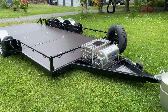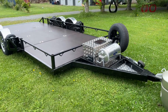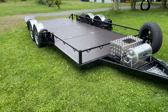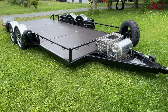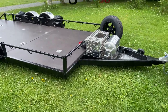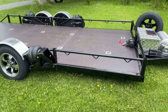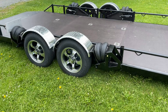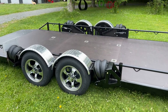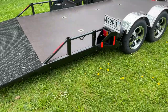Once again, I want to show you the latest — and every time I do a video, it's always the latest. So this is the latest. It's obviously a bit different. This one's black painted. We actually built it as a demo trailer for a show, and we ran out of time to get it galvanized. So we used a chassis paint that we've successfully used before, and it looks pretty dramatic. It's probably not as good as a galvanized coating because it will get knocked off over time, but it's special chassis paint — really tough, and it looks pretty spectacular.